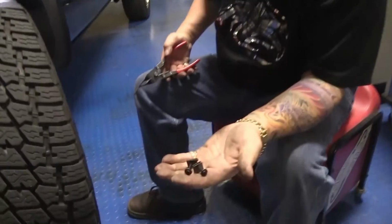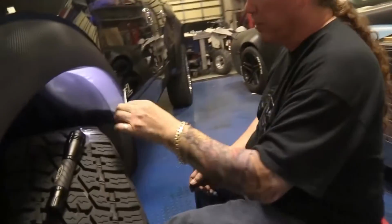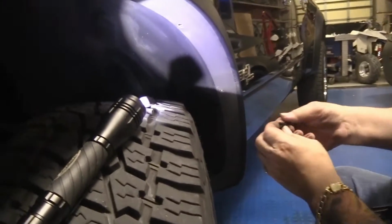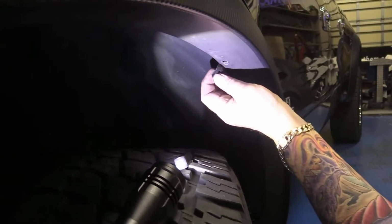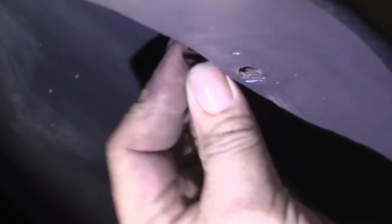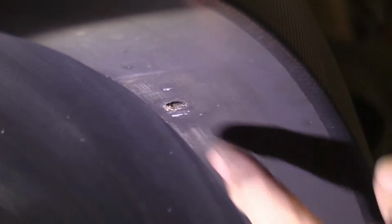You're going to take 2 of your number 10 screws, and we're going to slip this clip nut over that hole. You're going to line up that clip nut using your little scratch awl. So you separate this, put the threaded side out, and just slip it right over the rim of the fender. Just like that. And just make sure that your hole is lined up. Okay, now that's ready to receive the mudguard. I'm going to go ahead and put the other one in.